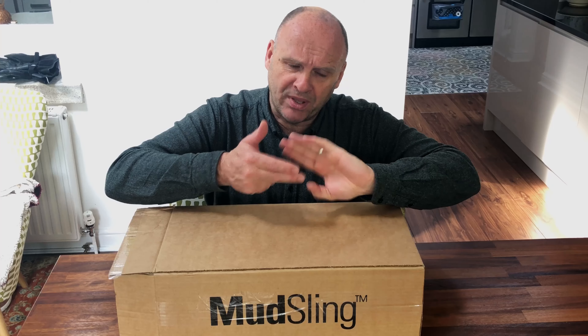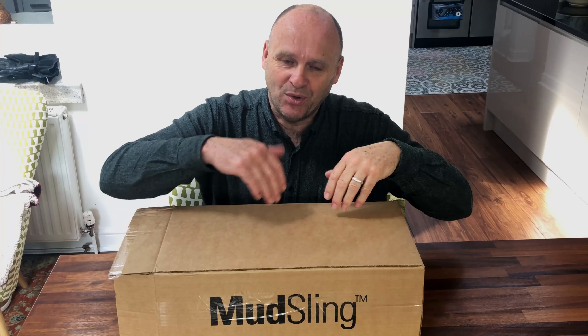You should be aware that the front fender extender will reduce the gap between the mudguard and the front of the engine. If you've got any engine protection plates at the front, go on to the Machine Art Moto website — they have a list of plates it works with. It works with the Wunderlich one, the Motec one, and the BMW one, but there are certainly a few listed where the clearance is gone and the front fender will hit the guard.